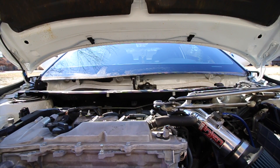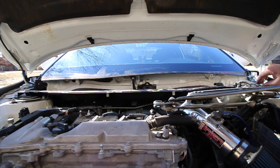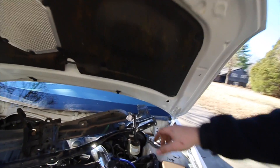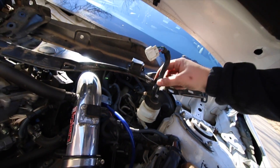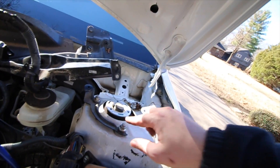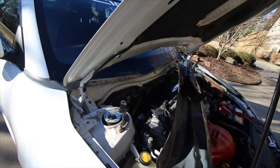So I just figured out that that little motor thing — because you have to pull this out — this little connector right here that provides power to the motor, you just undo that. That way you can actually take that out and move it out of the way. I felt like I was going to break it so I just left it. You just need access to these two or three bolts, depending on your strut bar, on each side. You can take this off if it's going to bother you, but as long as you have access, you just need to undo those.